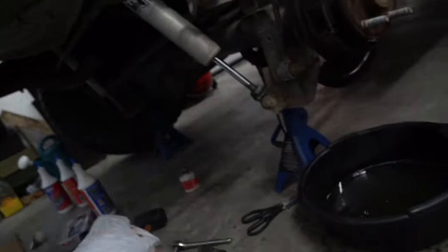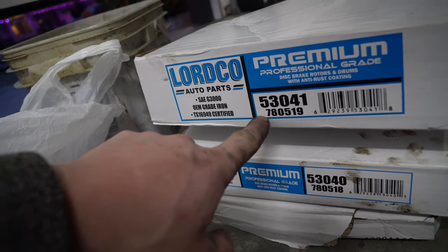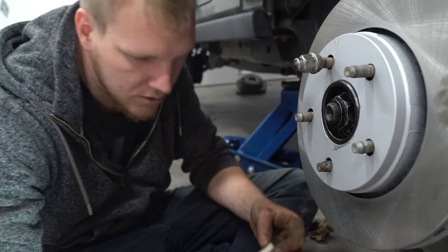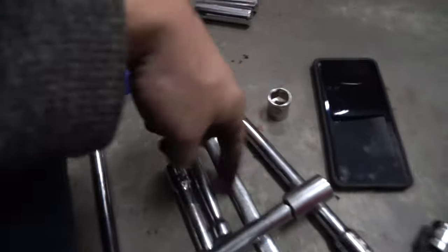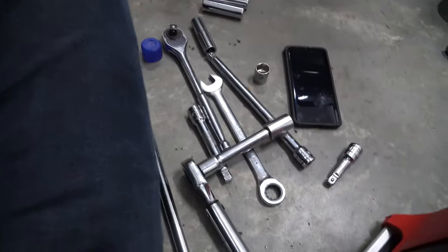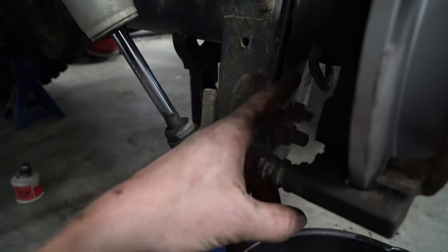After you have that ready, pick the rotor up carefully and slide it back over the hub. This is the part number of the rotors I'm using. Next thing I'm going to do is clean up that bracket with a little bit of brake clean and then bolt that bracket on — I'll give you the torque specs in a second. Put a little bit of red Loctite on the caliper bracket bolts. These bolts on the back need to get torqued down to 55 foot pounds. I grabbed my 18mm box wrench, went as tight as I could, then checked with my torque wrench and was basically bang on, so I trusted myself to do the bottom bolt because good luck getting a torque wrench in there.